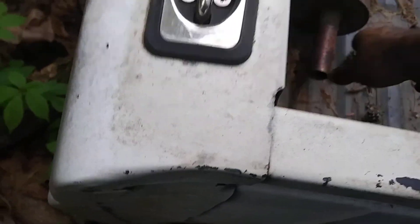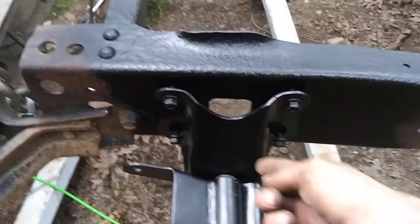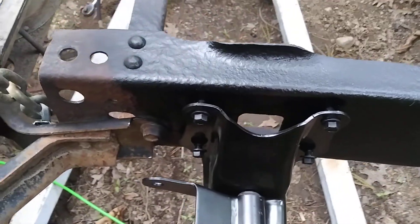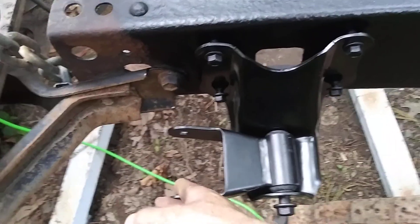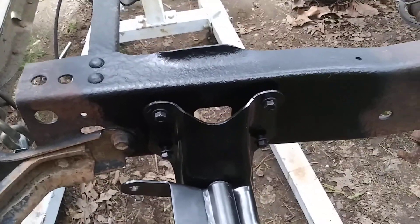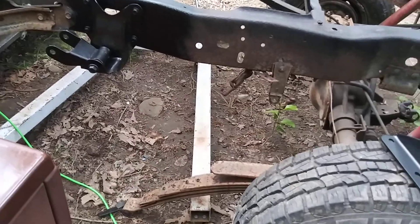The rust really wasn't that bad, it's just the old factory rubber undercoating, rust and scale. This is part of your structural part of the vehicle, so I don't want to play around with that. I just cut them like an X then cut back through with a cut-off wheel, ground them flush, took a hammer, did the old grandma rocking chair trick — rock this thing back and forth, hit it here and there, and eventually it pops right off.